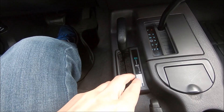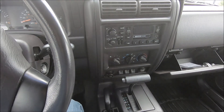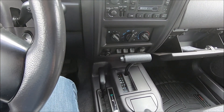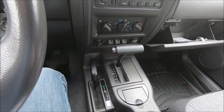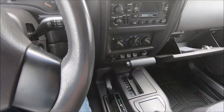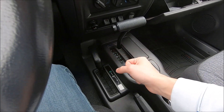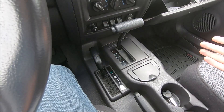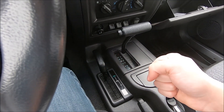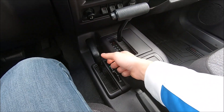Another important thing to note about the four-wheel drive system is that you don't want to shift from two-wheel drive into four-wheel drive while only your rear wheels are spinning, because the NP-231 is not equipped with a synchronizer. If you're on a loose surface trying to get out while only in two-wheel drive and your rear wheels are spinning, pulling the lever to shift into four high can damage the transfer case. So if you're in that kind of situation, completely stop first, then shift into four-wheel drive high — both of your driveshafts need to be spinning at the same speed for a good shift into four-wheel drive.